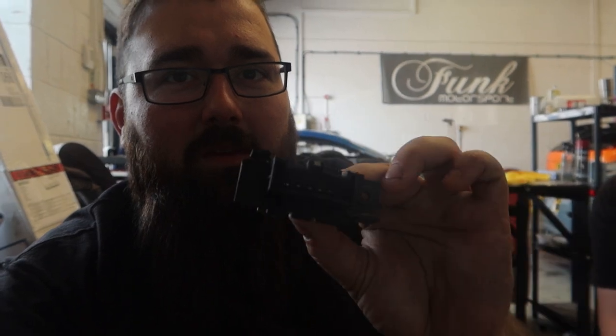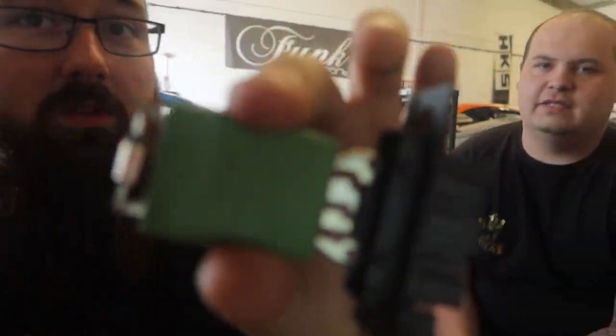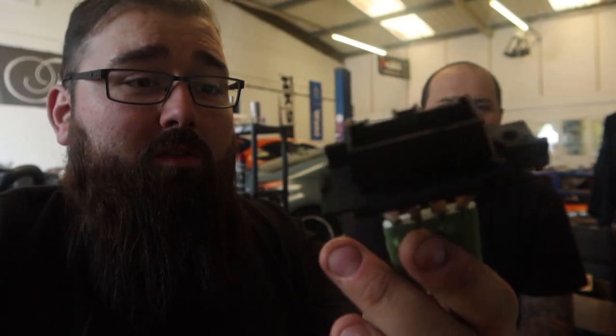It's not good when it gets all steamy in the car. So this is the resistor - this is what we're going to replace. These usually just fry out and end up only working on number four, or they just don't work at all. Jack's car has finally got this issue, so we're going to fix it and show you how.